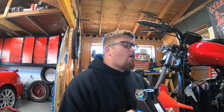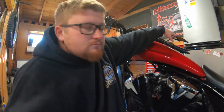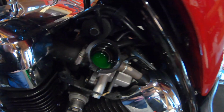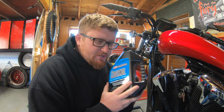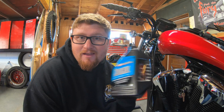Cycle it through again. I just wanna make sure I got all the air gaps out, and we'll call that that. Well, would you look at that? Exactly how I left it. Expansion tank just above the upper level. I'm satisfied with that. Perfect. It's about 1.8 liters of coolant for the system. This is 1.893, and I got a little bit left in the bottom.